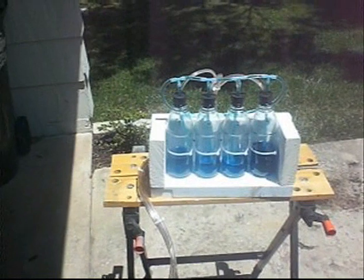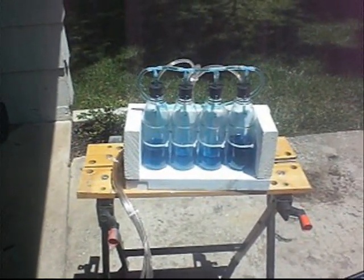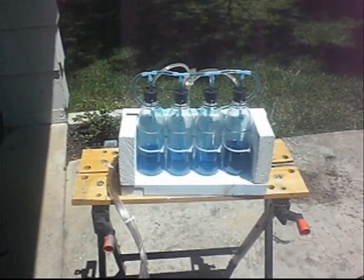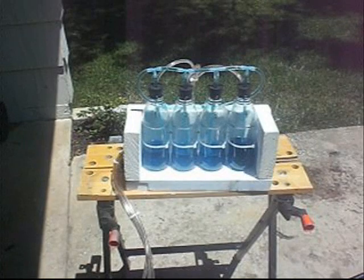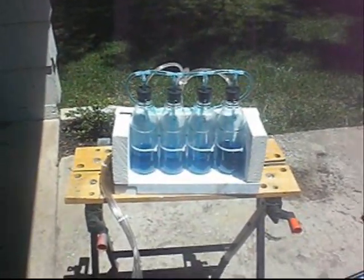You can see cylinder four is just a little bit strong, but if I go try and adjust that I'm just going to make things worse, so that's not so bad. The real test would be to see how close this is against a carb tune or some other factory tool manometer, but I think this is pretty darn close and we'll see how it rides.